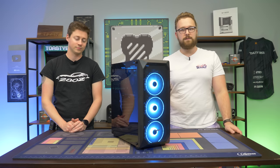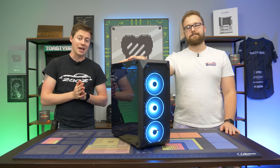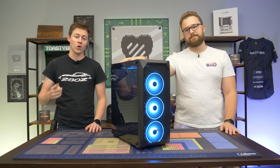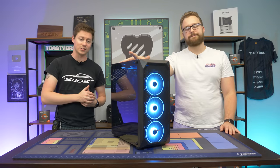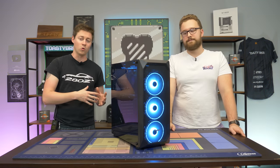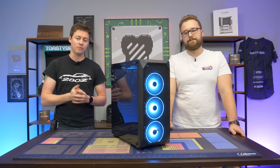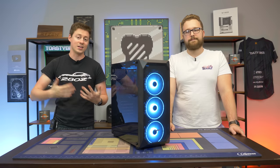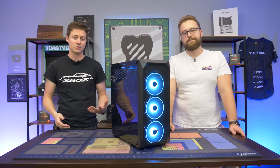And so this just goes to show that more cores and more threads do not equal a better gaming experience, because honestly, the Xeon would probably perform worse than something like a Ryzen 1200, which is just a 4-core, 4-thread, first gen Ryzen. They were pretty subpar, but they had a higher clock speed, stronger individual cores. And that's why we always tell people, hey, something like an i3-10100 is going to outperform something like a 7th gen i7. Even though it is an i7 versus an i3, you have really strong cores versus a lot of cores and a lot of threads, but it's not the strongest.